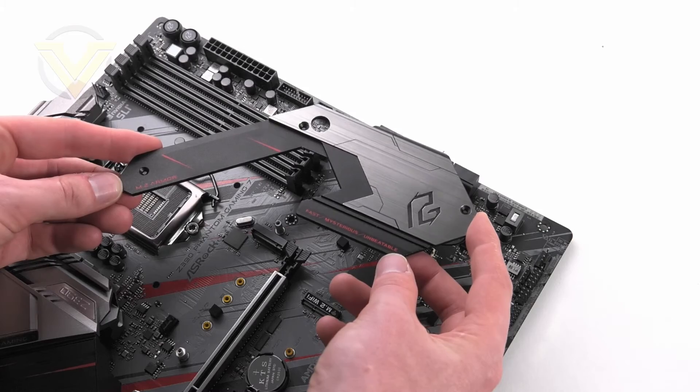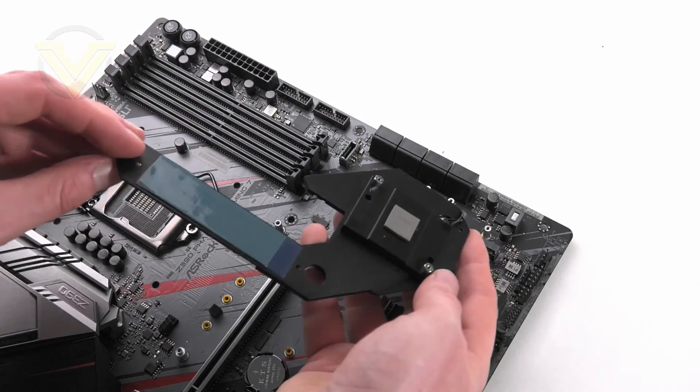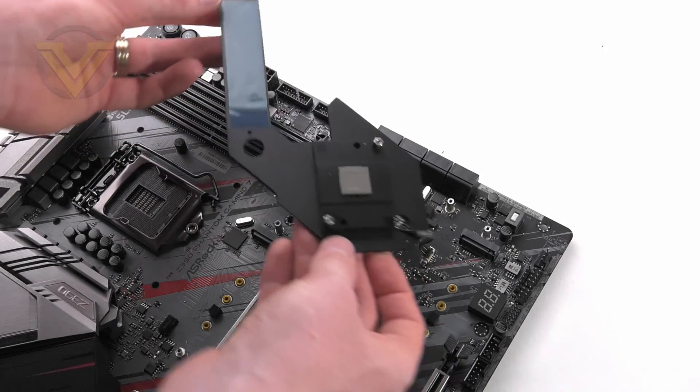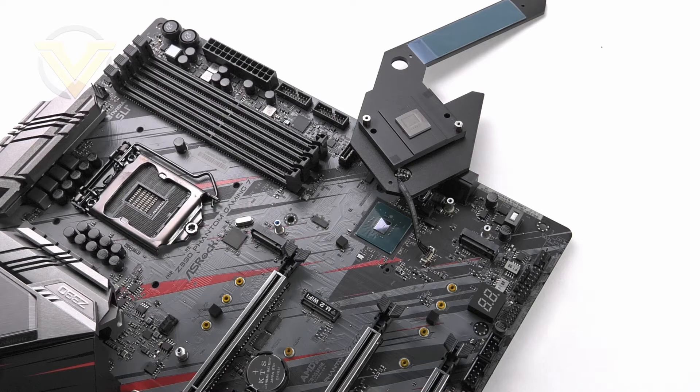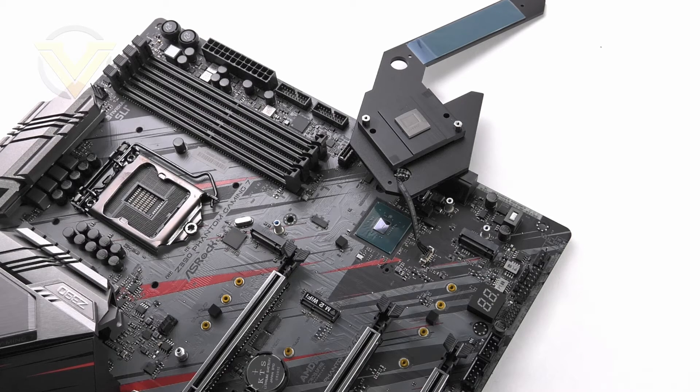This board looks great — I love what ASRock has done with the design. They've separated themselves from the competition and the grey PCB is both eye-catching and something of a novelty. However, the M.2 storage access is quite awkward, as the top slot requires the chipset heatsink to be detached. Not only is this annoying — it requires screws to be removed from the underside of the board — but for inexperienced users it adds an element of risk, because if that heatsink isn't properly reattached the chipset could overheat. ASRock should really address this approach in the future.